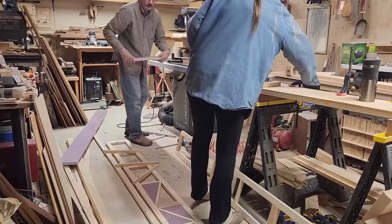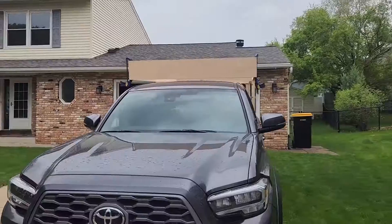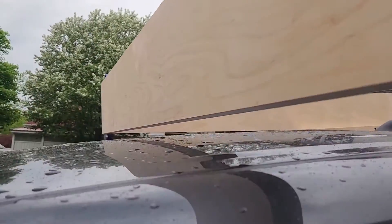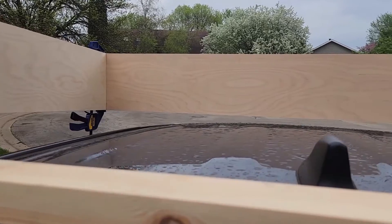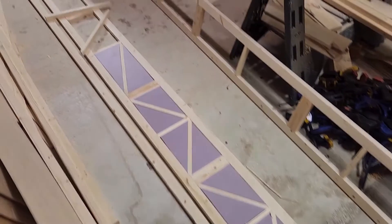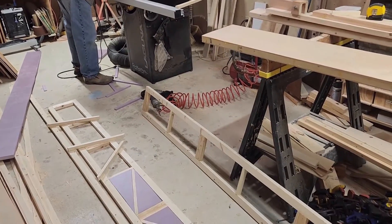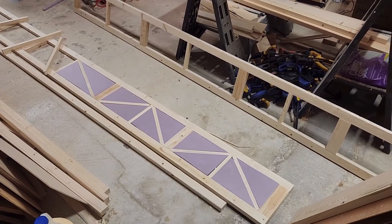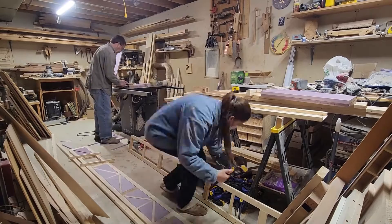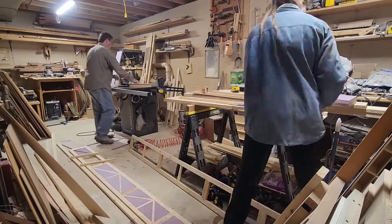Last week we finished building the actual beams that run and support the bed frame area — essentially a rectangular box that went over the top of the truck, kind of a cantilevered system. We had really focused on making those beams very lightweight. Instead of a heavy two-by-eight, we constructed a beam with truss support in the middle packed with foam to keep the weight down. The total weight of this truck camper is 340 pounds everything together.